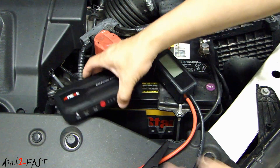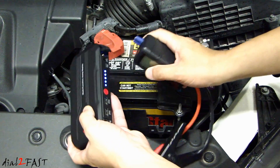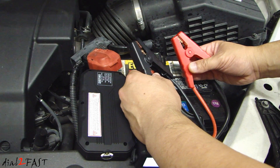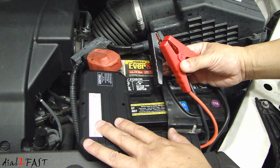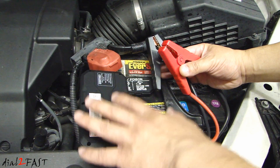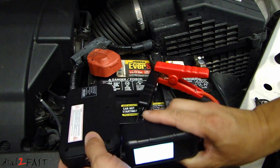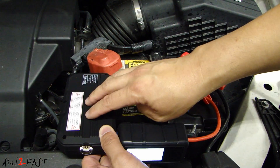I've gone ahead and charged this power bank. Press the power button once and you'll see all the LEDs are illuminated. Next, connect the jumper cable to the connector. Let me demonstrate the safety feature — if I connect the positive and negative clamps together, creating a dead short, it will not damage the battery cells inside the jump starter. On many other jump starter units on the market, this would short out the battery cells, resulting in permanent damage. As you can see, with the two clamps shorted, the battery pack is still powering the backlit LCD, so the unit is still working. The safety feature inside prevents this short from causing any damage.